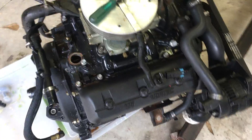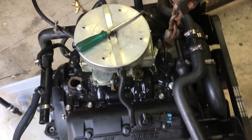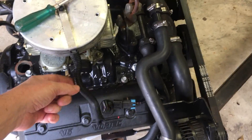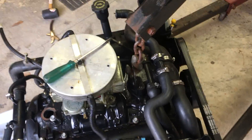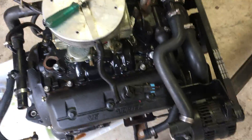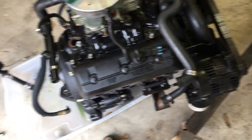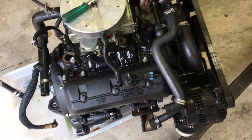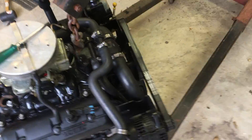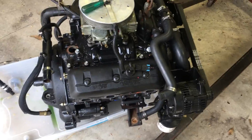So the harness is on the ground — here's the motor without the harness, looking a lot cleaner, a lot less stuff to deal with. This plastic hose right here is just an air passage from this device up to the flame arrestor. When the motor is running full blast, any blow-by gases inside the motor get drawn in and reburned. There's one on both sides. I don't think there's a PCV valve in this motor — that's how they get rid of the blow-by gases.